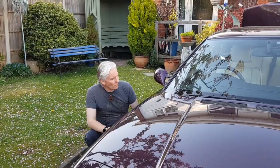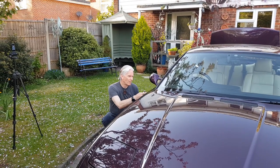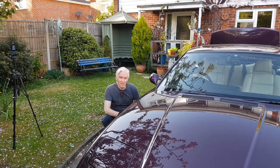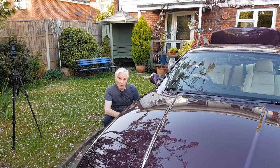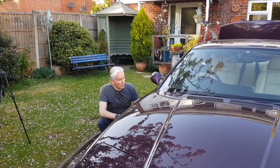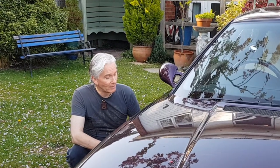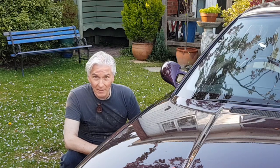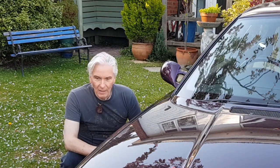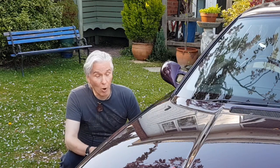That's another job all done. All the seals are nice and rubbery and finished to a nice matte finish, and they're not going to tear. Very important to do that, especially if you're going to put your car away for a while. What you'll find is that when you try and open the boot it won't open cleanly and will tear its way open and take half the seals out with it. Same with the doors as well - if the seals dry out they just stick to the doors and then they'll rip as you try and open them. Anyway, thanks very much for watching, thanks for subscribing and the comments, and I'll see you next time. Bye.